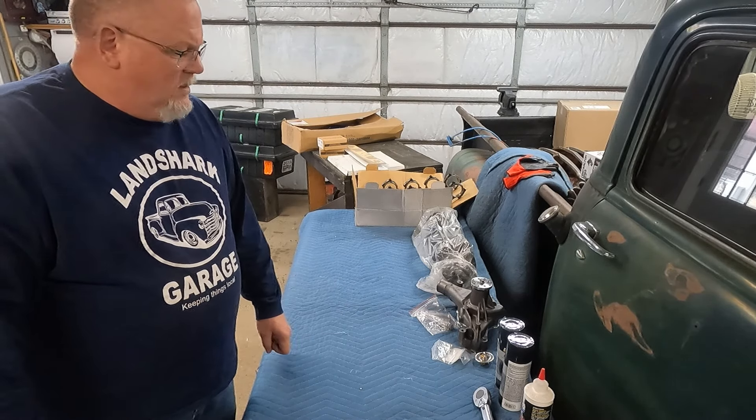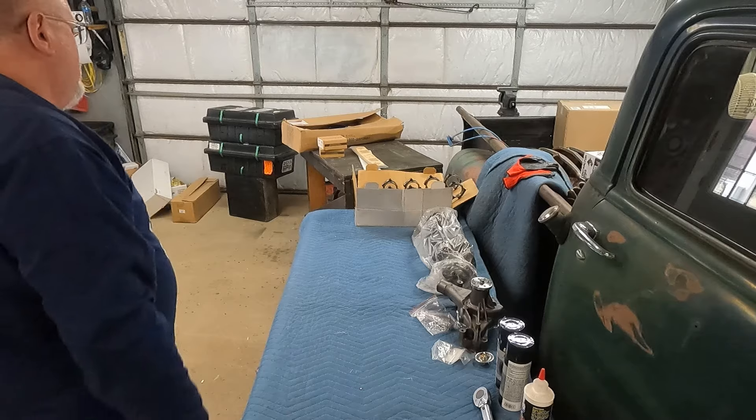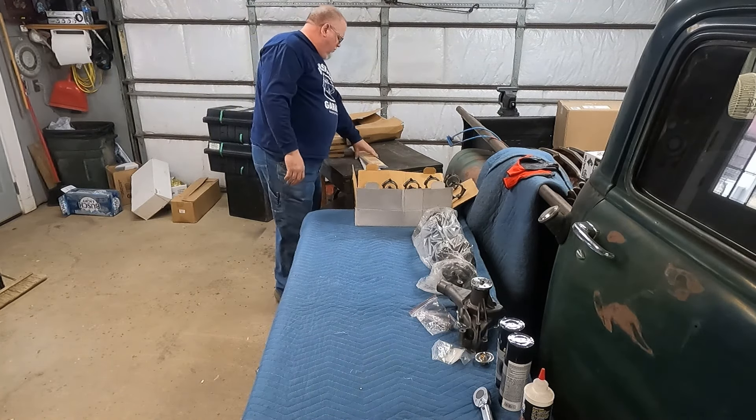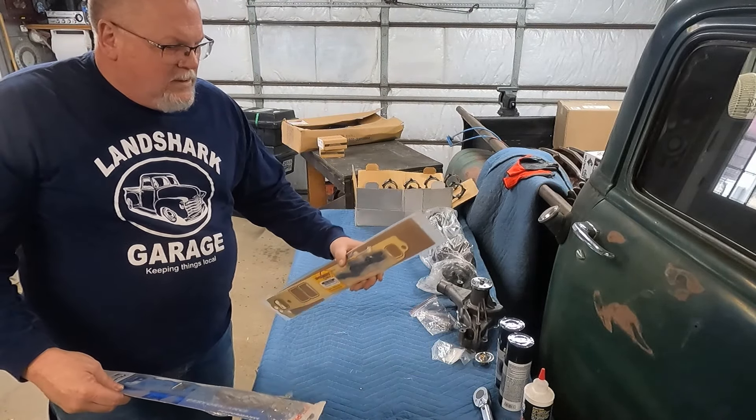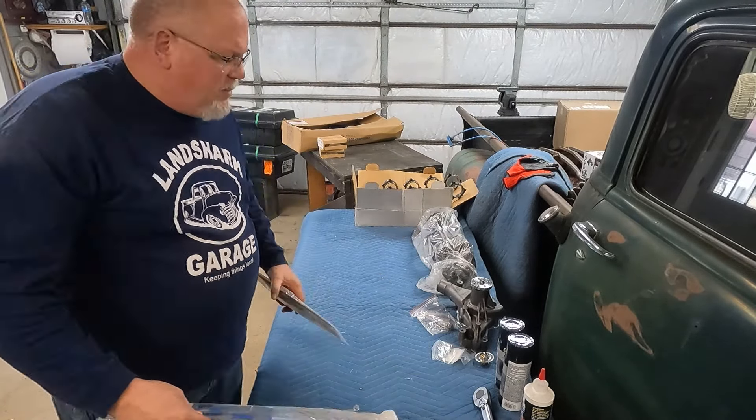New ring gear — that really isn't mandatory, but I know the ring gear on the 49 is time to be changed anyway; we've been having some starting issues that make me think it's ring gear related. Intake gaskets — these came with the less expensive intake manifold, but I like to use Fel-Pro 1204 gaskets. New head bolts. I ordered the engine kit from Northern and this is about as far as I've gotten to opening it, so everything is new to me.